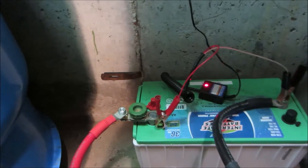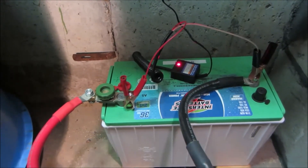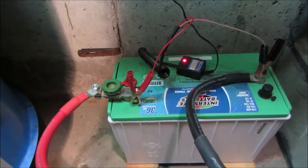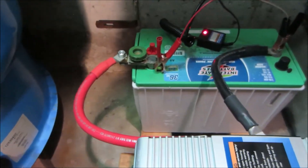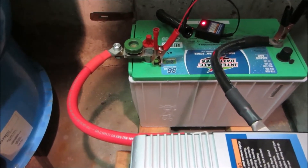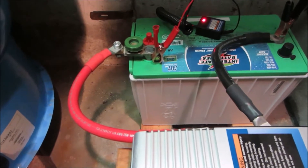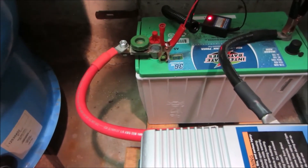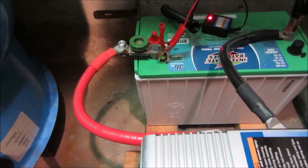What about these cables? These are one-aught cables — that's written 1/0. One-aught cable is the thickest cable that you can buy. They're probably close to $15 each with shipping. They are quite inflexible and very stiff; they sell slightly more flexible ones for a couple dollars more, and if you're doing this you definitely want the more flexible ones because it's very tough to make this connection. I originally started with 18-inch cables and could not get them bent enough, so I had to replace them with 12-inch cables, which is what you're seeing here.